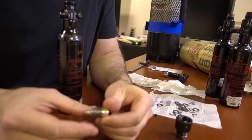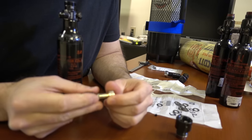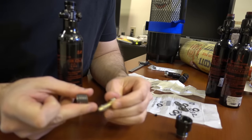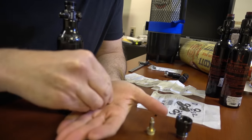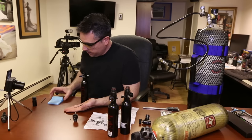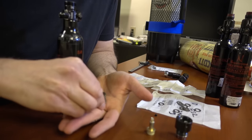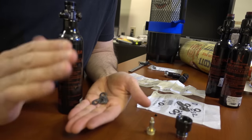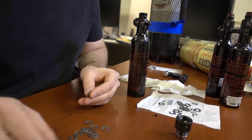Let me pull the Belleville washers off the piston. Here are the Bellevilles — and here is the piston. Now let's put it back together. Two in the outward position, four pairs facing each other, then two in the opposite outward position. Let's put them back on the piston.